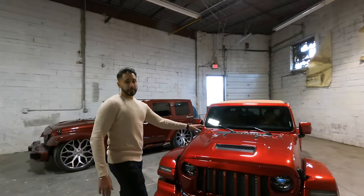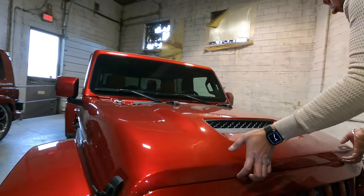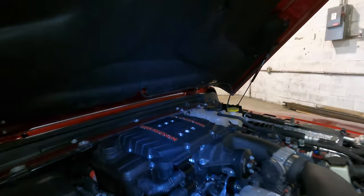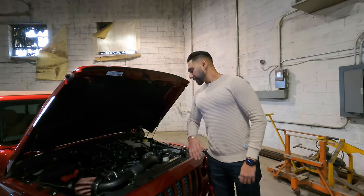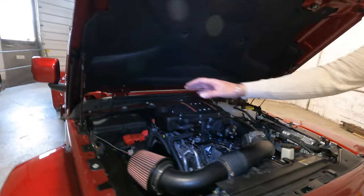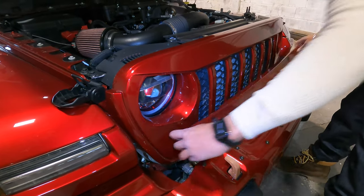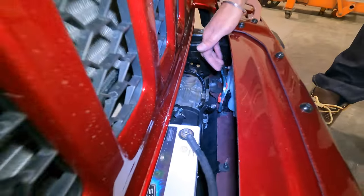First we're going to start off with the actual power plant. We went with a Magnuson supercharger because it's a stock motor — brand new, only had about 10,000 kilometers on it. This supercharger fits like OEM, everything is a direct bolt-on, and it comes with the HP Tuners kit that flashes the ECU. We went with a custom air intake setup because the upper control arms were hitting the air box. We also relocated the battery behind the bumper and relocated the washer bottle. The battery's here, that's the electronic steering pump, and the washer bottle is tucked behind the bumpers now.